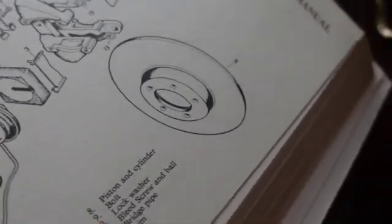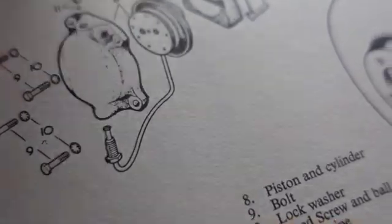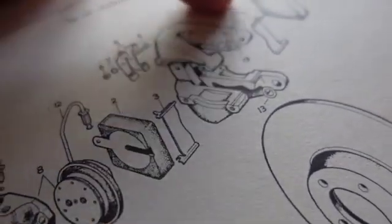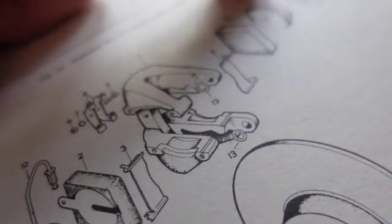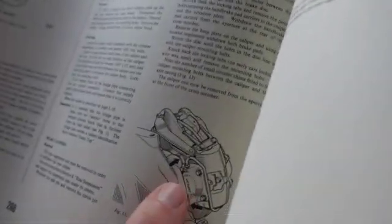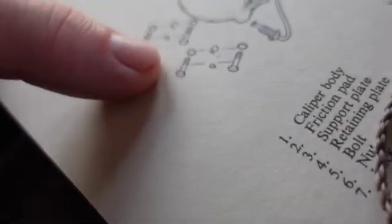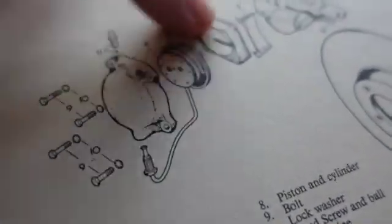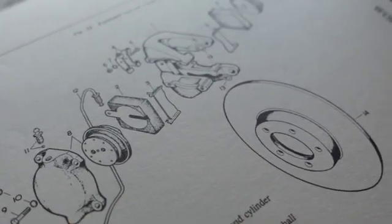The brake calipers, you just change out the little disc right here. You don't change the whole caliper. That's the caliper bracket. That always stays with it. So you just change these little pucks right here, basically, if you can still find them. I think I found some at TRW or something. But there they are in place, and they're, of course, wired in bolts. So you just change, there's 2 on each side, and it's a relatively simple thing to do. Remember, this is a race car. It's designed to be worked on.